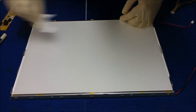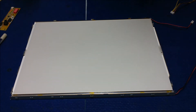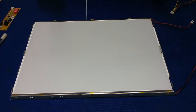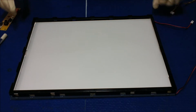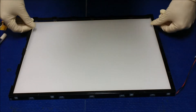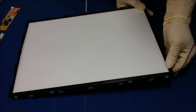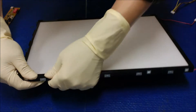Before you put back the plastic frame — now you're going to put back this plastic frame that holds the backlight assembly and diffusion sheets together. Make sure you get the right side, just put it back like this. Then push it back in front while you can hear the clicking noise, which means they are in place.